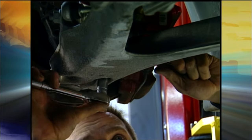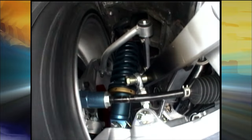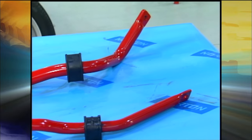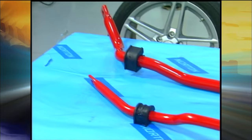That gives you an adjustable shock without needing to be a rocket scientist to make it stiffer or softer when dialing in chassis setups at the racetrack or for the street. By going to our Penske coilover setup, the car becomes truly four-wheel independent. When you have a transverse leaf spring, the springs are still somewhat interconnected across the car. With a coilover on each corner, each corner is truly independent. One of the most important final components is the tuned high-rate sway bars.